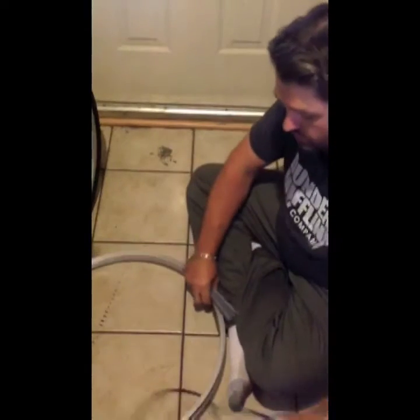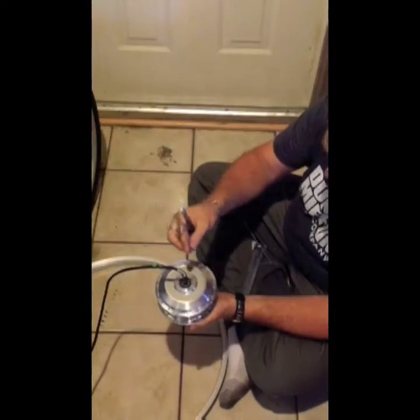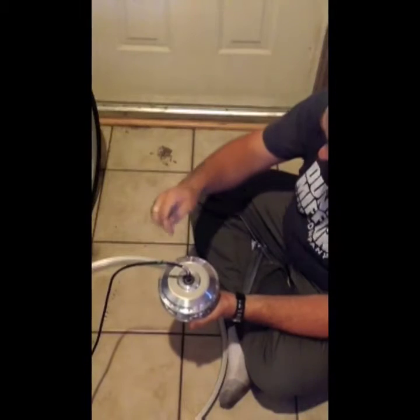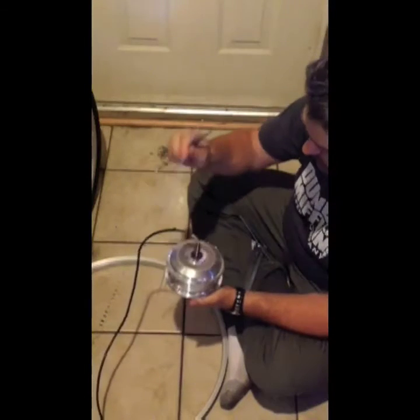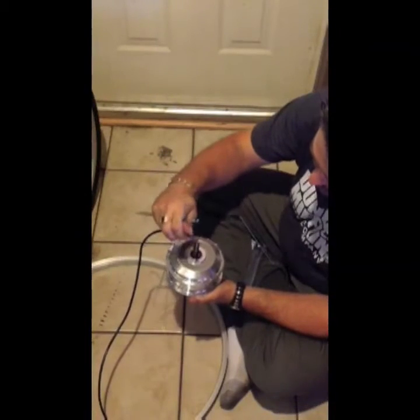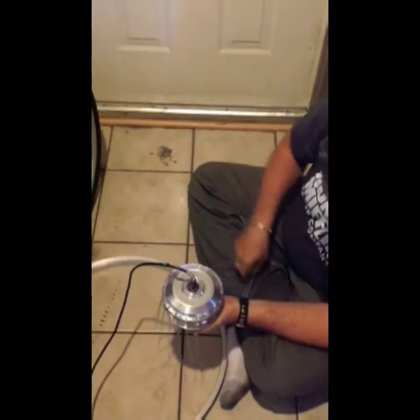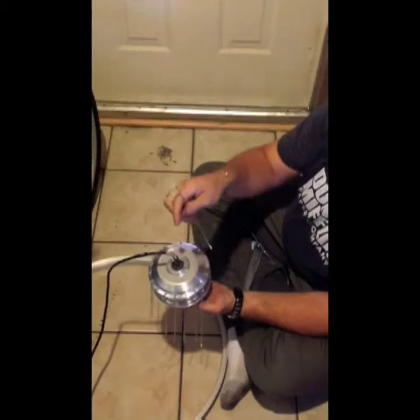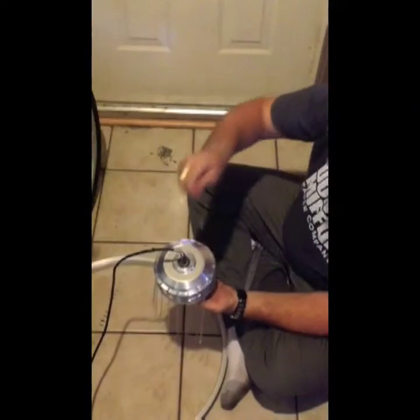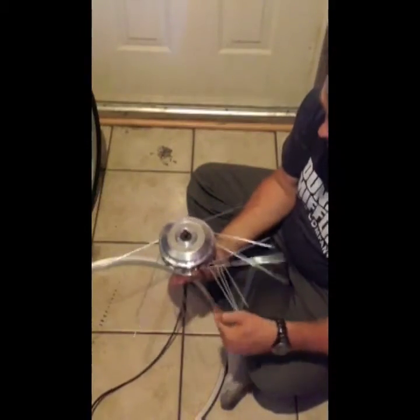Layout all your parts — this is the best spot I have to work in, so bear with me. To start, you want to take all your spokes on this type of wheel and lace them all down from the top, every hole. Because of the size of this thing, we're not going to be doing half on the inside and half on the outside, so that'll be 18 on the left side and 18 on the right side. Once you get the top ones all done, you flip it over and do the other side.